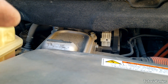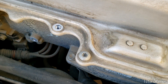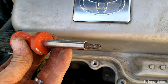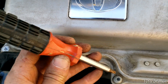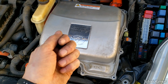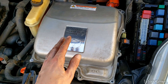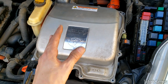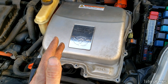The last one is a little star-shaped bolt — use an allen key or a star socket. If you don't have a star set, check a multi-screwdriver kit with bits. Word of caution before we take the lid off: we've made the car safe by removing the service plug and disconnecting the 12-volt battery, however there may be some residual power inside. Play it safe and use proper rubber gloves with no holes. This car has been sitting over two years so I'm satisfied it's fine, but worth mentioning.